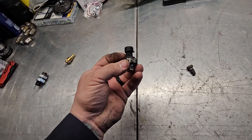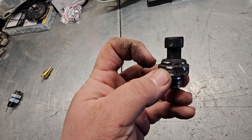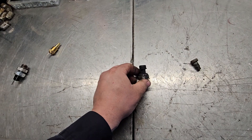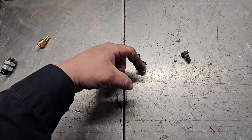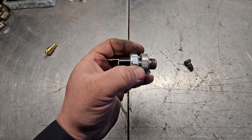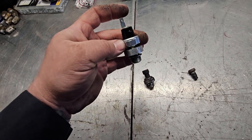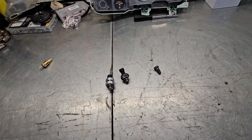For the oil pressure, you basically do the same thing — it's a sensor. You can kind of see right here, it has a little bevel top. Cut it completely flat, take all the guts out of it, drill the hole out one size, and tap it for the new single wire sensor fitting — just like this. This is a new single wire oil pressure sensor — tap threaded, drills right in. That's your budget tip for today.